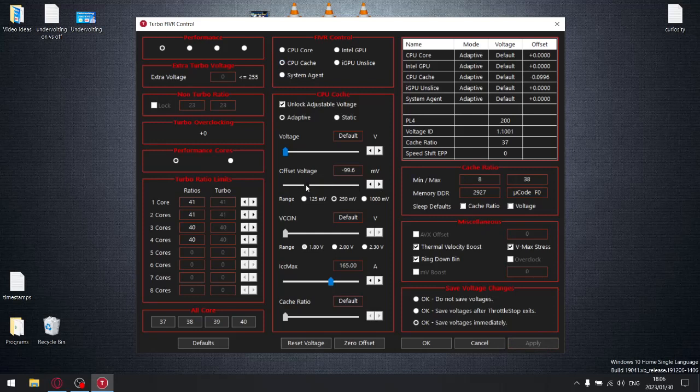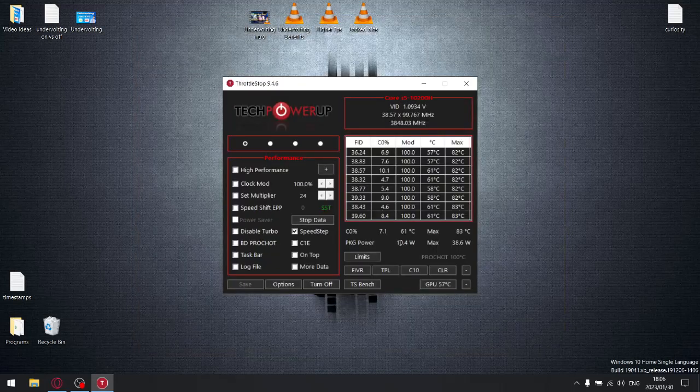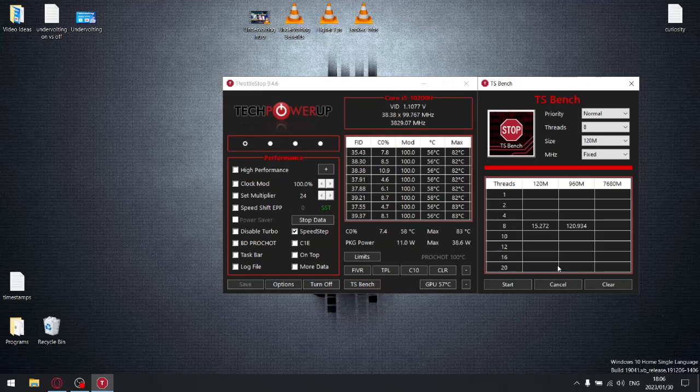And the CPU core — let's get this to zero. So if you just look here now, I've taken my undervolt off, and now I'm going to use TS Bench just to stress my CPU. It's only a 15-second test, but you'll see my temperatures go quite high. Straight off the bat, my temperatures are going into the mid-80s, borderline the early 90s. And that is with undervolting off. My maximum temperature there was 88, and that was just a 15-second benchmark.